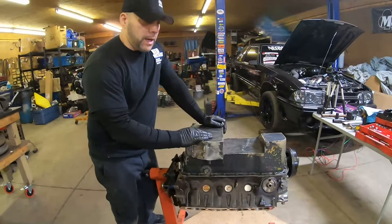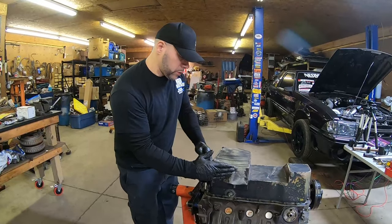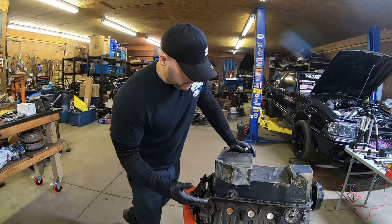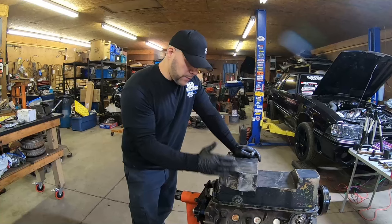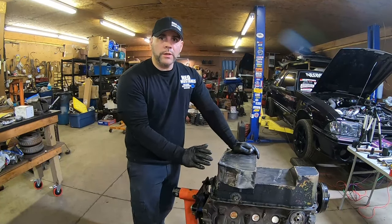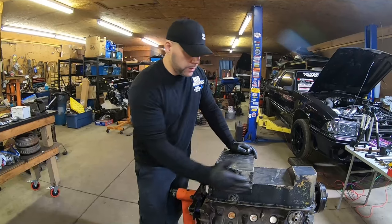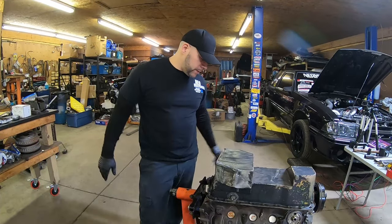One of the issues that we had with this oil pan is the fact that my clutch cable used to be more squared off like this. We took this whole corner out because I run a T56 Magnum bell housing. The clutch cable at the 7 o'clock position with the bell housing on the T56 was literally torquing the cable, so the cable wasn't able to have a good clean throw to it. So it'll now be able to transition around it. We had to cut that out. That's why you see that.